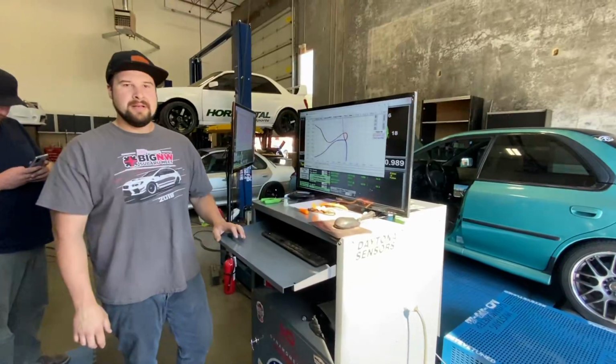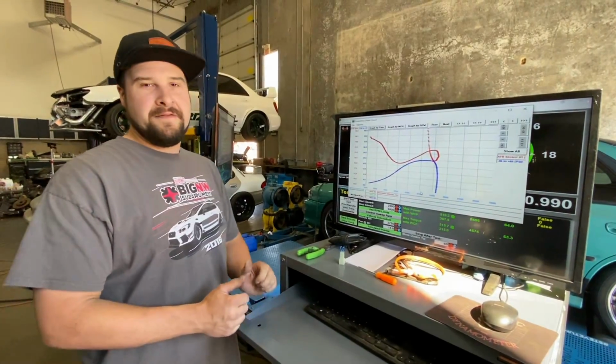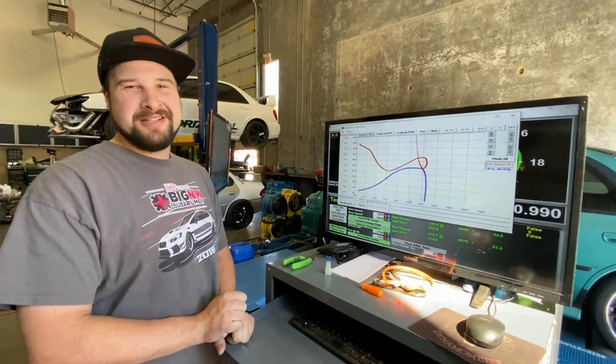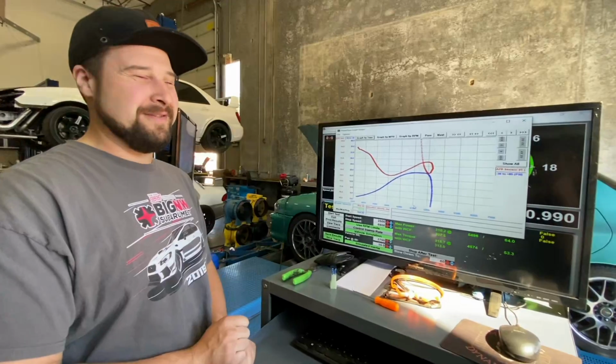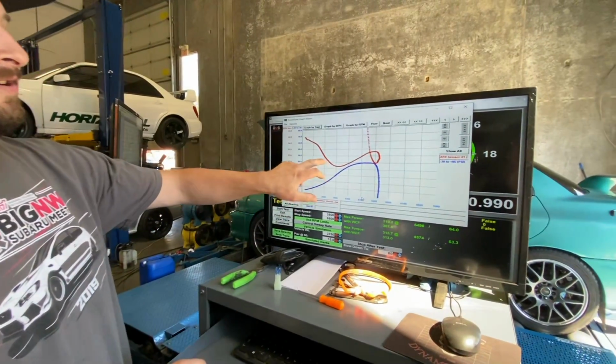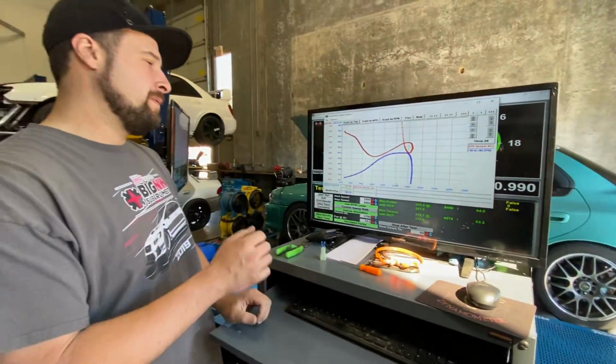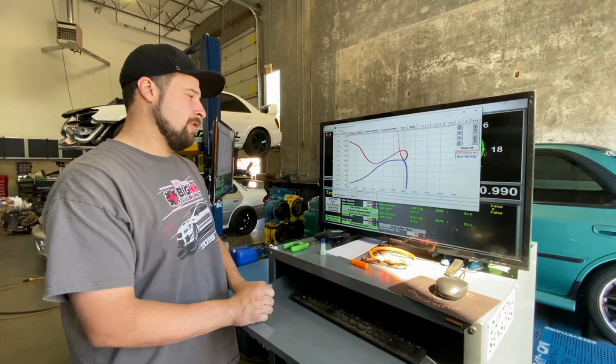All right. Well, we're gonna end the video on this one. I've cut it a little short because we ran out of fuel. So everybody that watches knows every once in a while we get fuel problems around here. It's kind of the name of the game. If you don't have fuel, you can't make power. But you can see here, air fuel ratio is just taking off on me. I can't get it under control. So fuel pump needs to be replaced and hardwired in my opinion.